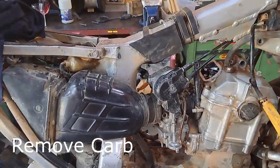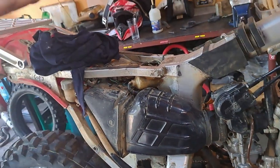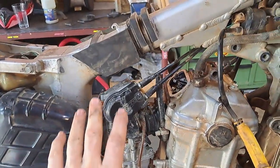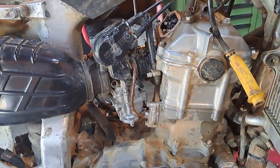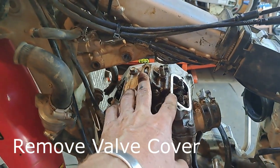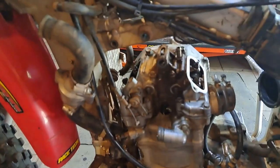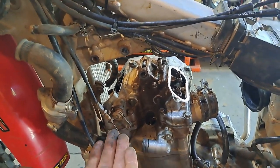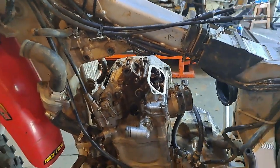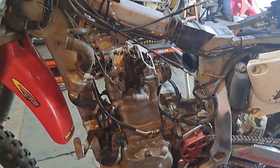Each carb is different - have fun battling it yourself. I don't usually pull the swing arm or the subframe up but I think others do. I'm just gonna manhandle this. Remember boys and girls: you need to keep it at top dead center when you're doing engine work. Why? To relax the cam and the tension on the head, because if you don't, those cams are pushing up and as you start to remove it, it can cause problems.